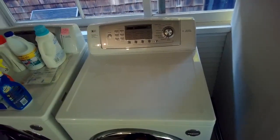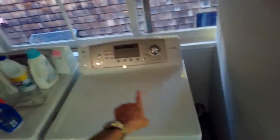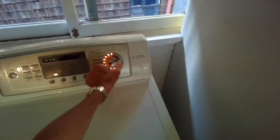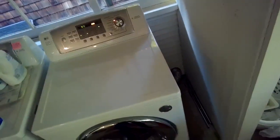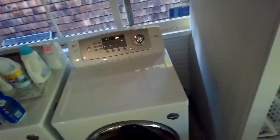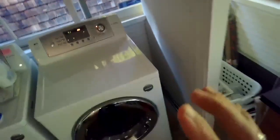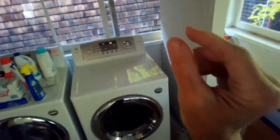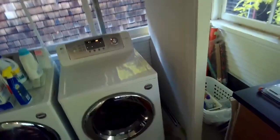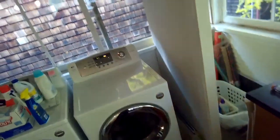This is Scott the fix-it guy. Today we have an LG Trom gas dryer that is not heating up. It powers up fine, set it for normal, turning great, everything's working as it should but we're not getting any heat. I removed this side panel — a little plastic piece — pried it off, looked in there and could see the igniter glowing. So the igniter does glow and does work. I know it isn't the thermal reset button, because if the thermal reset is blown you won't get the orange glow from the igniter. So the igniter glows but it doesn't fire up.